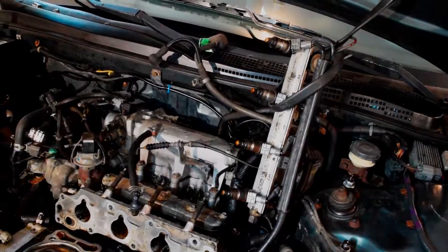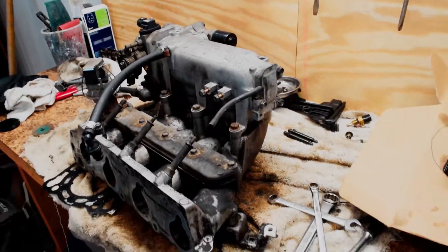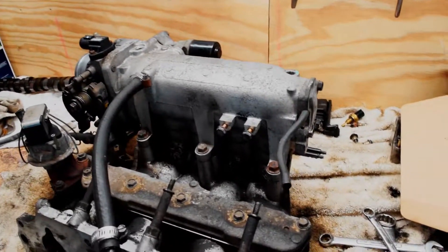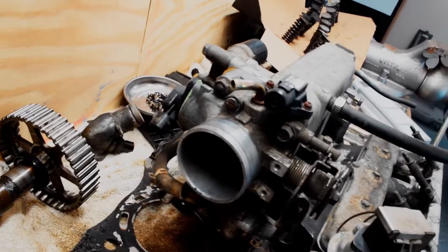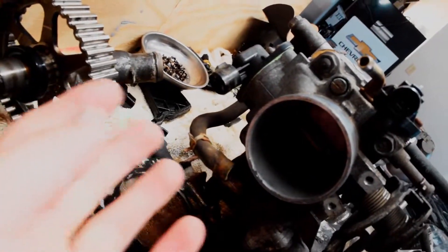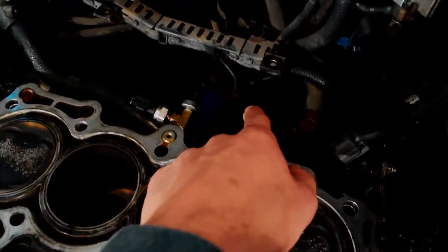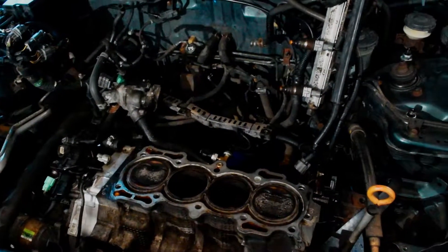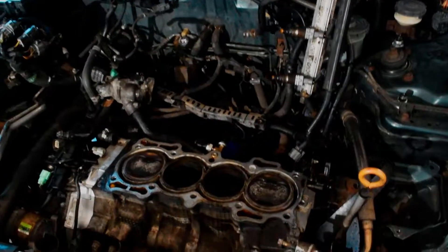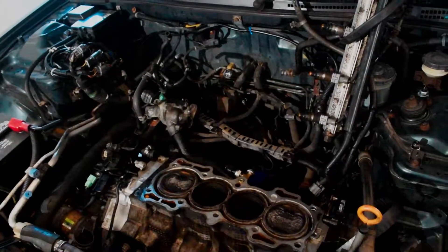I got the intake out — not too bad, it was relatively easy. Things you'll probably forget: there are a couple of 12mm bolts that go up from the bottom. Just unplug everything; there's something to unplug back here, and cooling hoses on the back. Those 12mm bolts are here and here and hold the whole wiring harness to the back of the intake. It's easiest to get them by lifting the intake up and cranking them out from there rather than going under the car.